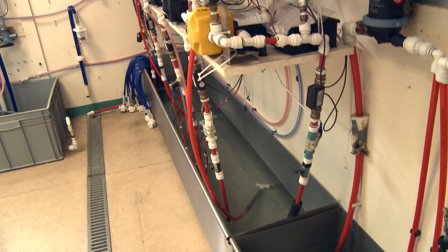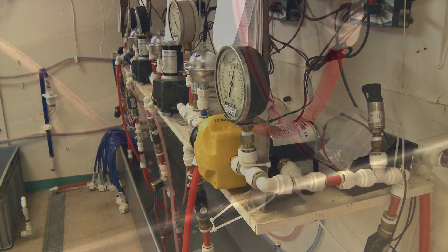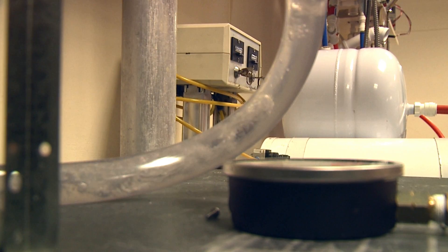So to sum up, what are the main advantages of this product? There are three really. The first advantage is that you never need to adjust the pressure switch again. The second is that it will shut off automatically when you run out of water. And the third is that because it has slow start-stop technology built into the control circuitry, you don't need a surge damper — you get smooth flow right across the voltage range.